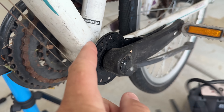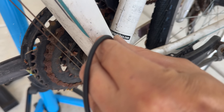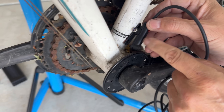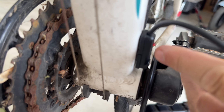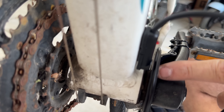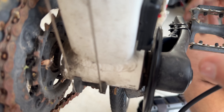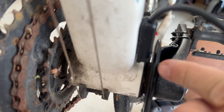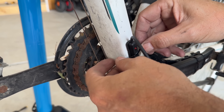This piece is the sensor for the magnets, and they want us to put it as close as we can — right there or there. Got the sensor mounted just with some two-sided tape. You've got to make sure that the round part of that sensor is meeting the magnets. You don't want a very large gap, and then you want to zip-tie it after you put the tape on.